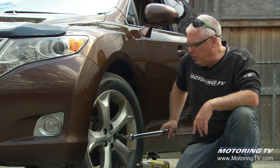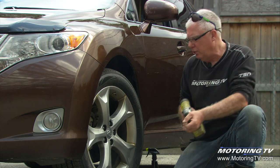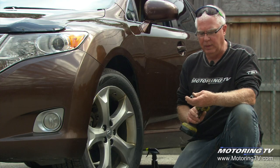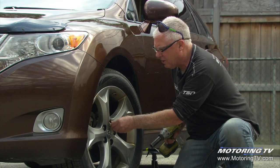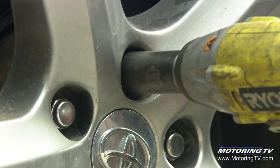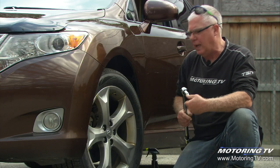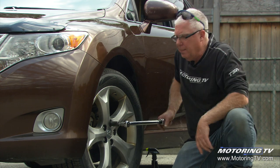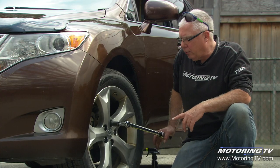This is the proper way to do it. You'll often see that when servicing a vehicle, we use power tools to get the lug nuts off because it's way quicker, and it's much quicker to reinstall them. There are 20 lug nuts on this vehicle, so if you're changing over from summer to winter tires or vice versa, you've got a lot of lug nuts to remove and reinstall. The gun gets it done really quickly, and it's fine for taking them off — but to confirm they're properly torqued when you're finished, the best way is the torque wrench.